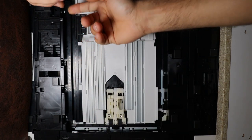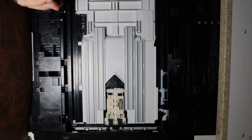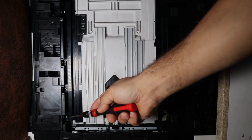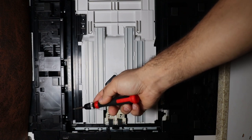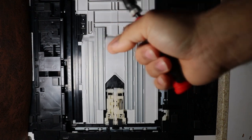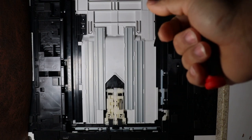So this is what I found the easiest: we're going to be removing this bottom plastic piece right here on this side. There are four screws — I'm trying to get you guys a good view because there's not enough light. That's one, two, three, four — those are going to be large Phillips screws. And underneath that one there should be around six countersink screws, so you'll be able to tell the difference. The long screws are for the bottom and your countersinks are for the top. So let's get started.